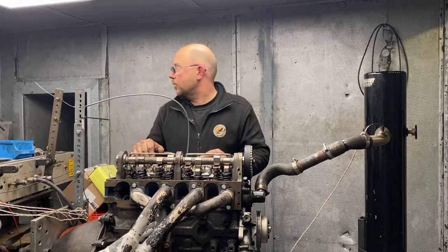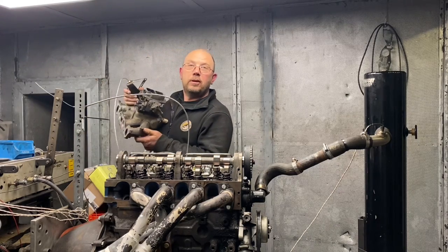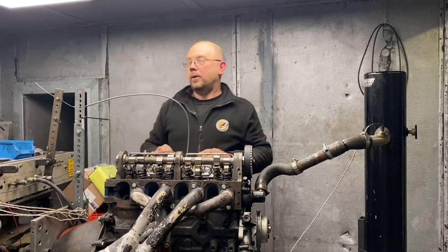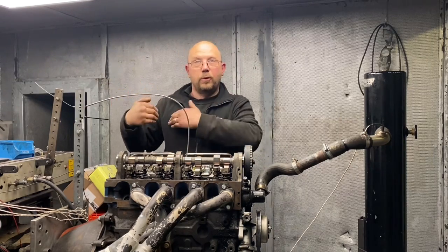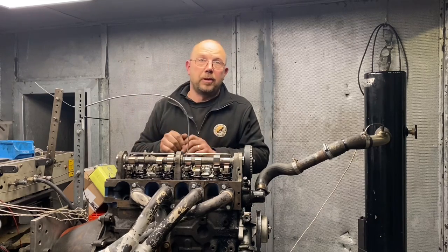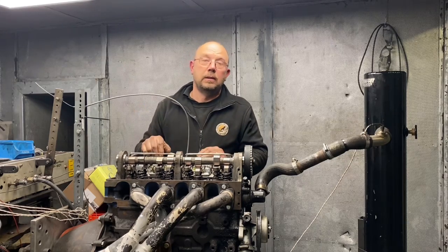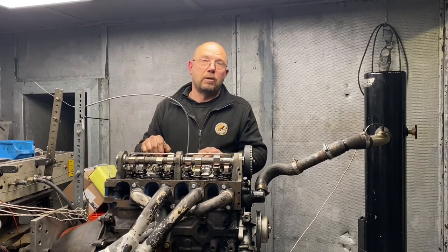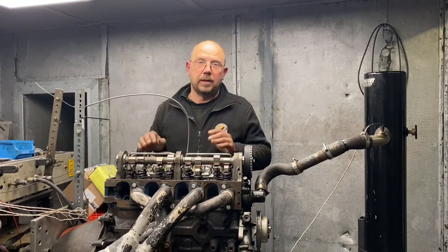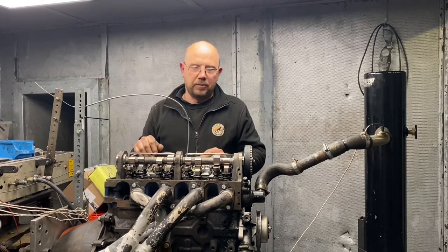In fact what we might also do, just out of curiosity, is try the same engine on a 32-36. If you compare a completely standard engine on a 32-36 to the 40s and 45s there is no power difference whatsoever up to about 4,000 rpm. With a modified head and cam I would expect that to change slightly, but at very low revs I imagine the 32-36 will match anything the bigger carbs have to offer — but as the revs go up the power difference is going to increase.